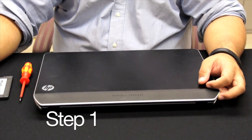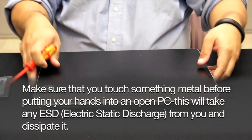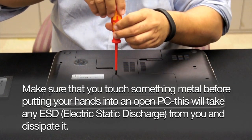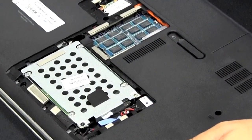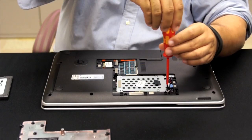Step 1. Turn off the laptop's power. Disconnect all notebook power cables. Turn the notebook upside down and remove the battery. Locate the hard drive panel on the bottom of your notebook — refer to your user manual. Unscrew and remove the panel.